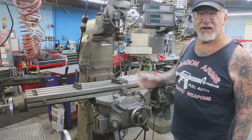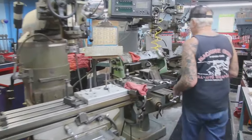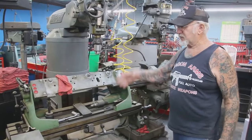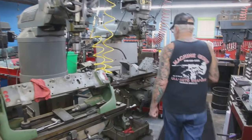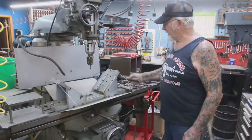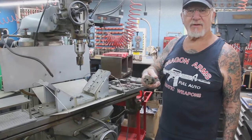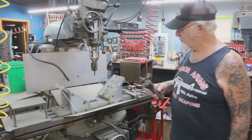I have all the Harley-Davidson blueprints — I can relocate every hole after it's welded up. Over here we relocate the spark plug holes; right here we weld up the spark plug holes, drill it out 9/16 — it's 14 millimeter. This machine here cuts out the pan head seats. These flutes are cut three to four thousandths smaller than the seat, giving me a three to four thousandths interference press fit.